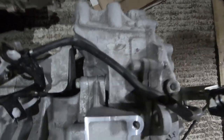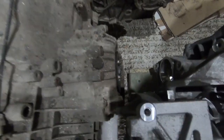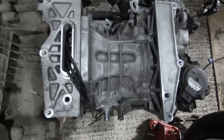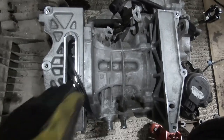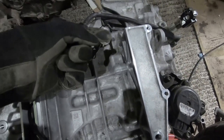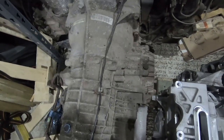It's only really at the point where the drive is coming out of it that the gearbox has any width. And unfortunately for us, that's almost the narrowest part of the Leaf motor. On the Leaf motor we've got a drive shaft coming out this side and going through and out this side. On the Porsche gearbox the drive shafts come out either side and any of the width is lower down. The Leaf motor on the other hand is overall blockier, and as I said, it's actually mounted transversely — the rotation is this way — and then the gearbox transfers it to something similar, just at a different speed. Whereas on the Leaf, the rotation goes that way and within the gearbox it gets transferred for drive to the wheels.